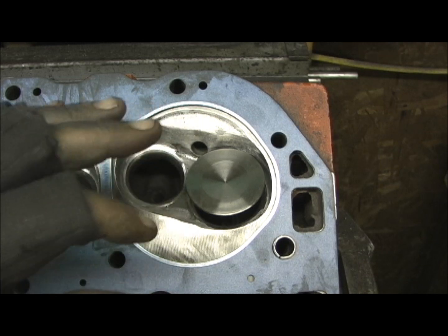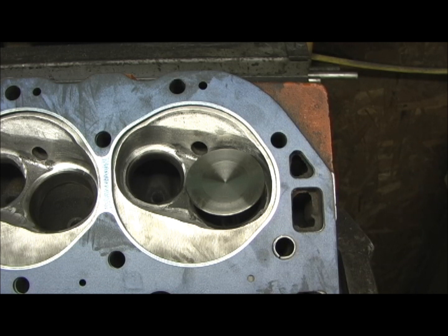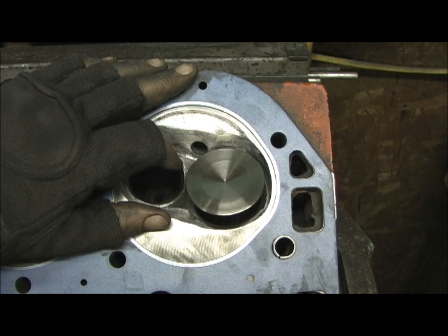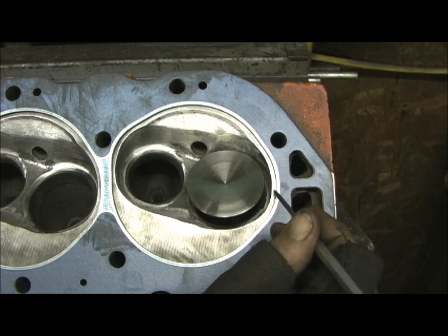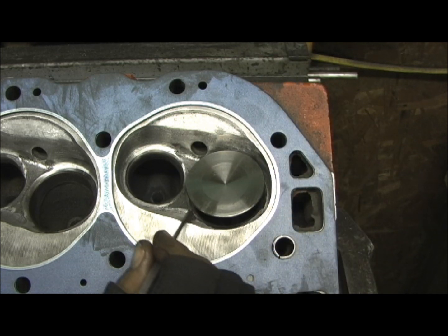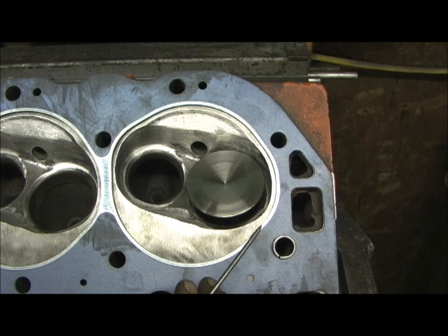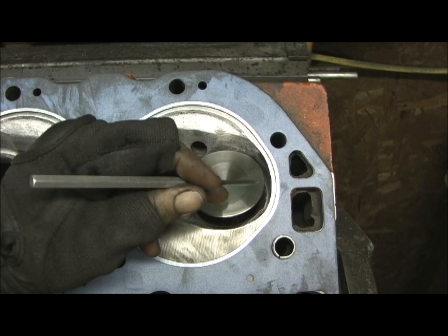So other than this one thing, it's identical to a Stage 4 on a 454. I just wanted to show what this is like on the cylinder head when I'm doing it for a 396 Stage 4. There is a difference in the smaller valve size and not quite as much unshrouding. Although I do butcher it — I've got probably about 15 to 17 hours cutting material inside the combustion chamber just getting it set up, whereas normally I'd have about 20 to 22 hours in there for the 454.